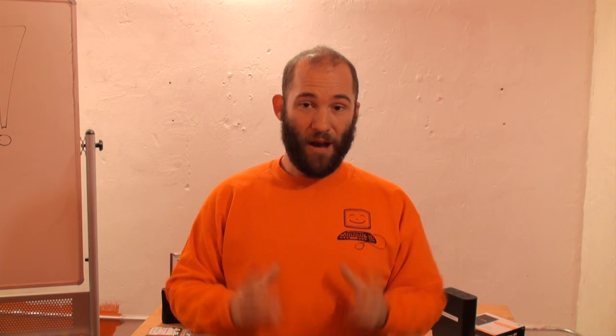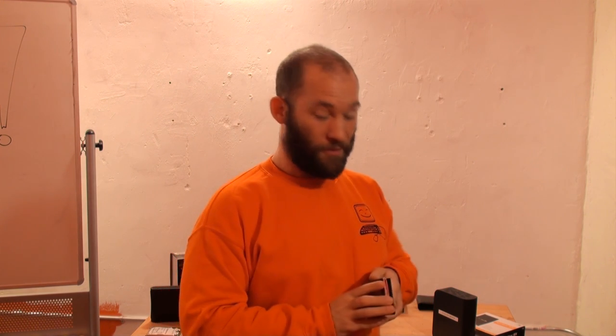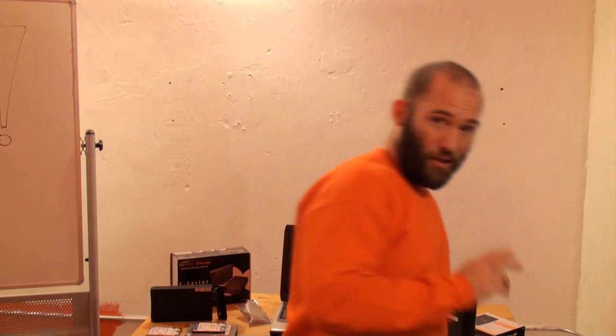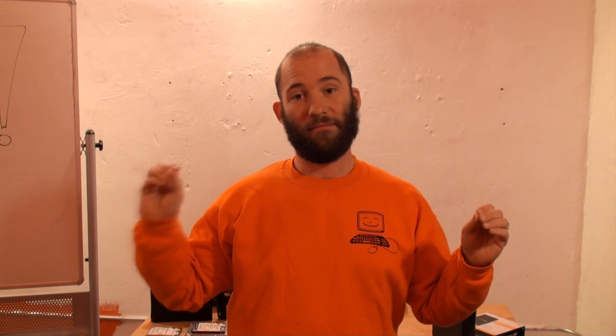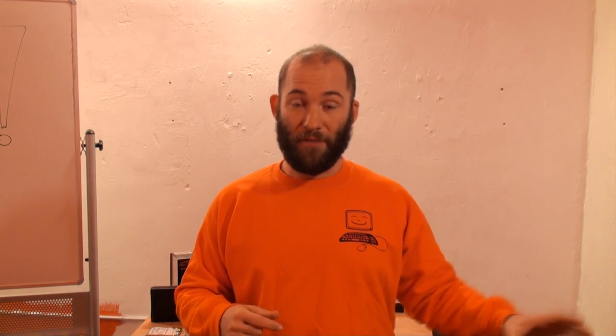When buying a hard drive enclosure, you have two sizes: the laptop version — the small one, like a Western Digital Passport size — or the large desktop hard drive version. This isn't a beginner class, so you should know something about computers. With these enclosures you have two sizes and two types of interfaces: either IDE hard drives or SATA hard drives. If you're going to make an external hard drive you'll actually keep, buy the appropriate size with the appropriate interface.